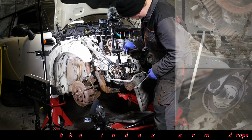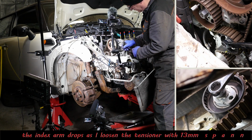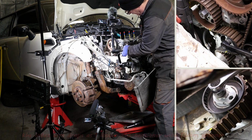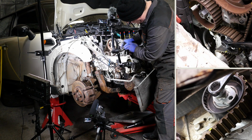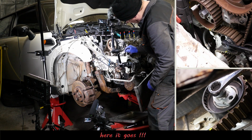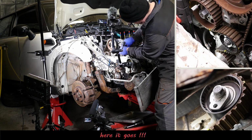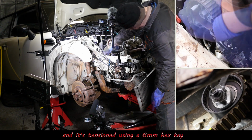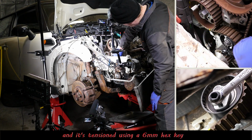Now if we go to the tensioner, as I undo it, if you watch the index arm, it should start to drop lower and lower. I'll try and undo it slowly so we can watch it. Here it goes, it's starting to move. There we are. And then it drops down. And then I'll just try and show you how it moves around there